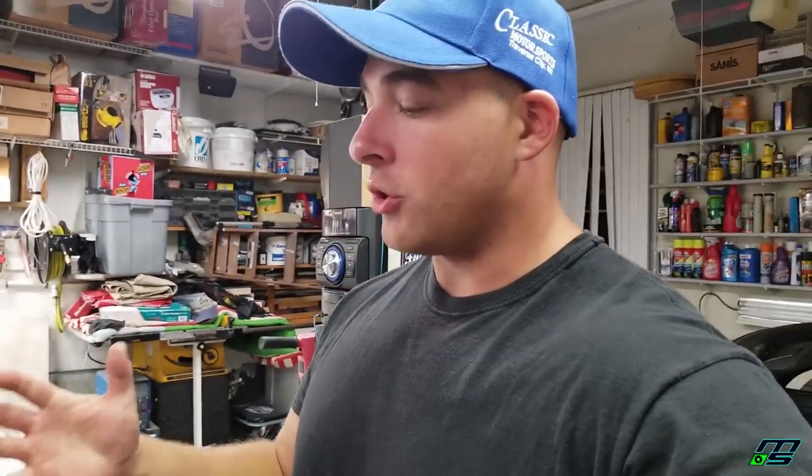I wanted to make a little video for you guys showing just what it feels like with that hydraulic clutch, to really feel the difference. That's really where it matters. And it wasn't quite disengaging the clutch. I pulled in that clutch and it was dragging a little bit and I couldn't really shift gears that way. So I have to do a little bit of an adjustment.